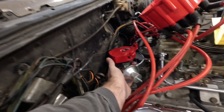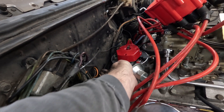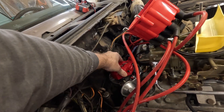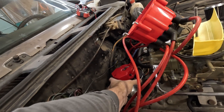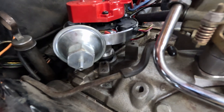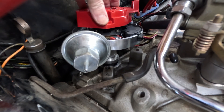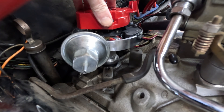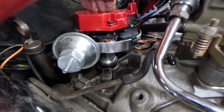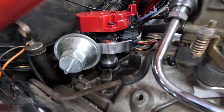It's going to want to turn clockwise, so you want it about so. The other thing you're going to run into is the oil pump shaft — there's a little shaft that goes below the distributor that it has to connect to. It's not going to be lined up, so what you're going to have to do is pull it out and look — let me just show you.